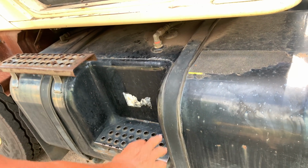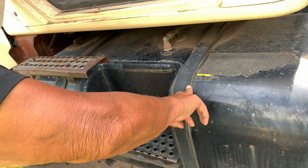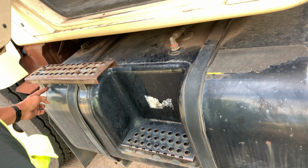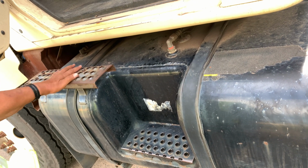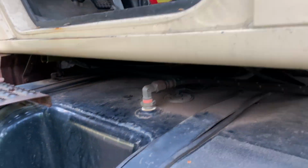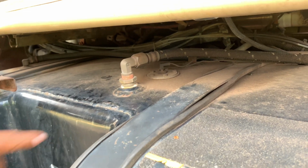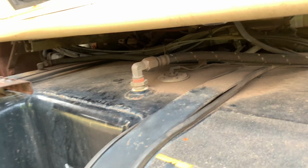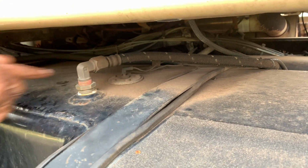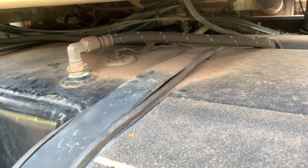There's no damage to the rubber, no cut, crack, or tear. They're tightly mounted. We check the step and the welds, they're not cracked, no hole, no leak, no rust. This is my pressure release valve. It releases the pressure in the tank. Tightly mounted, threads not stripped or damaged. The hose goes over my electrical sending unit wire, no bare wires, cut, crack, or fray, no arcing.